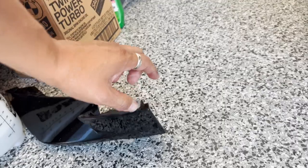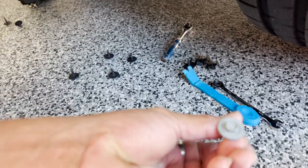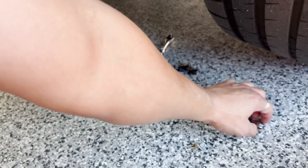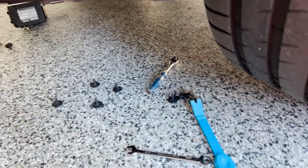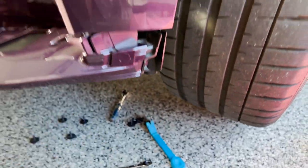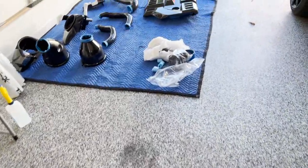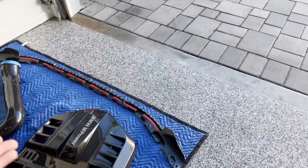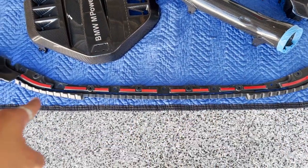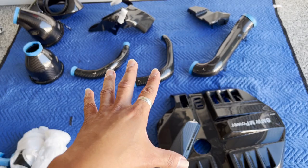There's a little screw that holds the corner part. Once you unscrew the supporting screws that go on the side, you'll get to the screw that holds this part — that would be inside. This is the clip that the screw goes into. This is the little 8mm screw — it's a little tough to get in there, but if you have a little wrench you can definitely do it. Everything also just clips in and includes clips for the new lip.